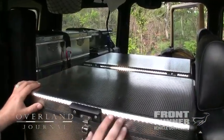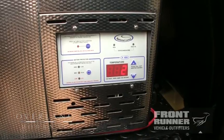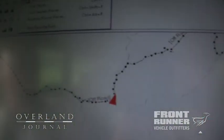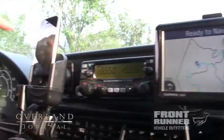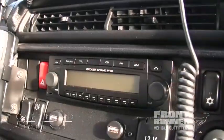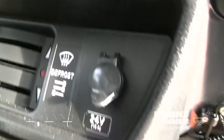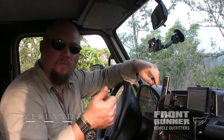For refrigeration, they've got two 50-liter National Luna units with very good insulation and very low power consumption. Up on top there's a 10-inch LCD screen that flips down and accesses a computer kept in the glove box. This Nexcom unit allows connection to the monitor and also running of moving maps. There's also a simple Garmin Nuvi unit that runs tracks for Africa. For communications, there's an ICOM unit that does both two meters and 70 centimeters, an iPhone adapter integrated with the Becker Grand Prix stereo unit, and an Iridium satellite phone fully integrated into the vehicle. There are also two 5-volt USB outlets and a 12-volt 15-amp outlet. This truck runs on both 12 volts and 24 volts, so it has two alternators and three batteries — two combined for 24 volts and one at 12 volts running the rest of the truck.